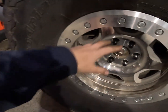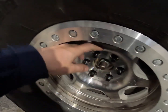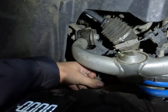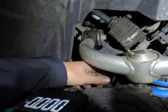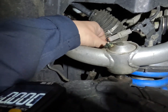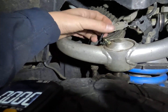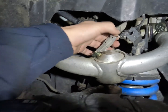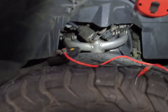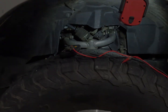I can't actually get this wheel off because the customer doesn't have his lock nuts, unfortunately. But he said he's replaced the whole hub assembly, so we're assuming this is just a failed sensor. The aftermarket sensors they initially tried to put in are no good. The fact that this did happen after a lift kit as well makes you think the harness probably got stretched or damaged down here. We know our wiring up to this connector is fine, so most likely it's going to need a genuine new sensor and it should be good to go back on the road.